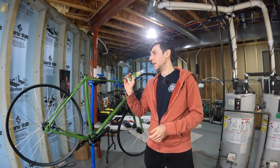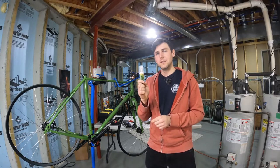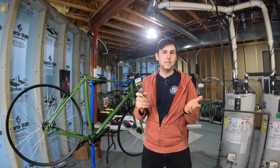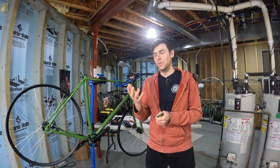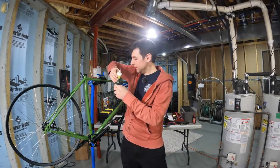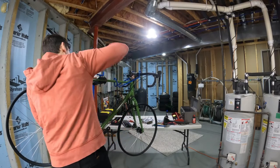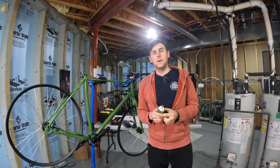I'm going to put some on the inside and go for a fairly thick coating. I like anti-seize because it's not messy at all — it barely feels oily and the copper particles kind of stay in place as the oil washes away. With grease you have grease everywhere; even a thin layer attracts all kinds of dirt and if you touch the seat post you get grease everywhere. The anti-seize really isn't that much of a problem. I'll just run a bead around the inside of the seat tube and then get some on the seat post as well.